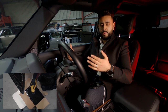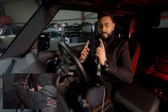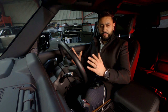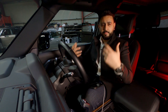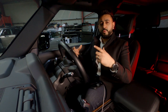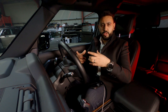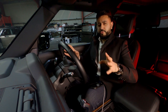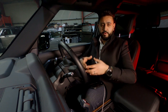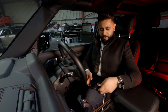Like our client has experienced here — and we've seen many times — these things rattle like absolute crazy. But not to worry, it's all been fixed. We've put 50 sheets of soundproofing across the vehicle, plus we've added some bass with that 10-inch sub, taking the strain away from the doors. And what we've actually managed to do is recreate that bass curve using a product called the Audio Control LC2i. Hopefully that gives you a bit of an understanding about the fundamental flaw of sound systems on the Meridian system on a Jaguar Land Rover. Now it's time to have a little listen to how it sounds.